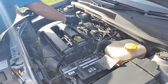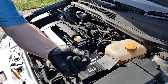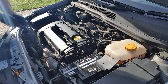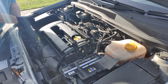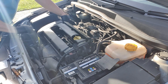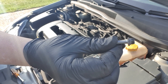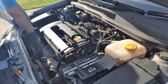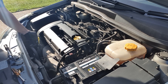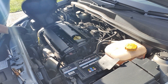The upper timing belt cover is this bit of plastic here, held on with two Torx bolts — comes off with a little female Torx socket. These aren't very tight, just sort of hand tight really, and they come out quite easily. If you've got any requests for more detailed information on this, just drop a comment down below. Once both bolts are removed, the cover just slides off — pulling forward to free it from the cam cover and sliding out of place.